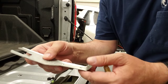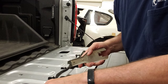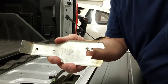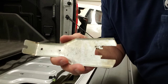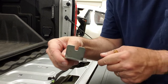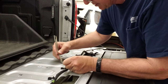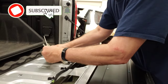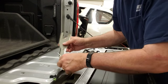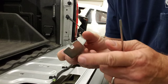I made this little short tool for pulling out these knobs right down here. I took a tool from my toolbox and slotted it out so I can get underneath these clips. I'm going to get underneath like this, lift it up a little bit with the screwdriver and get this underneath — actually I don't need the screwdriver. Works out great. I'm going to do all these like that so I can save these clips. I already wrecked one before I made this tool, so you've got to make yourself something to pull out these clips.